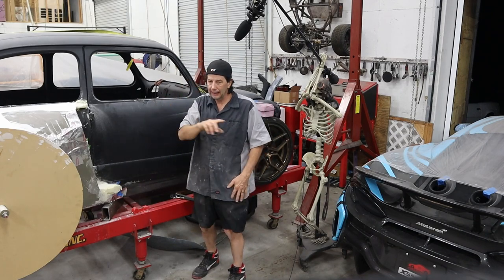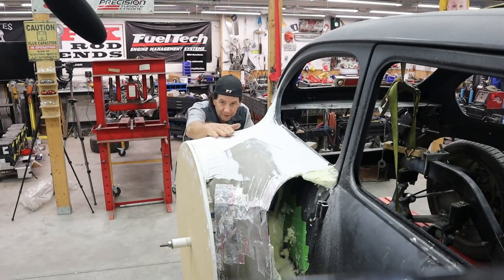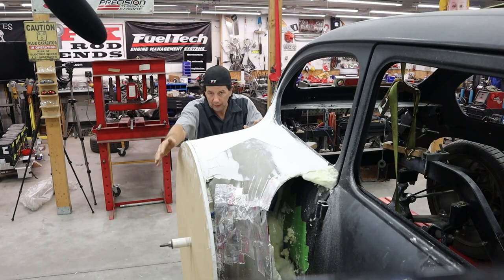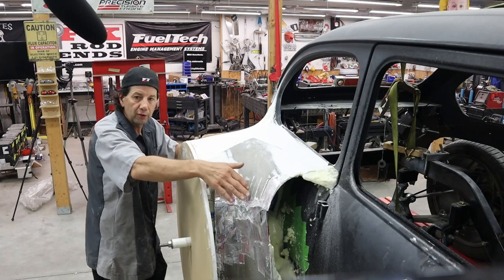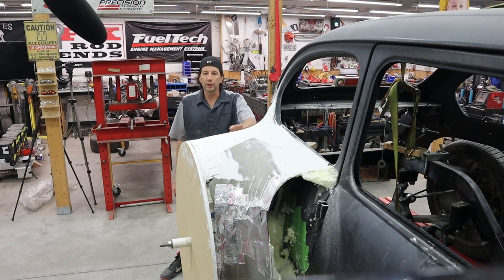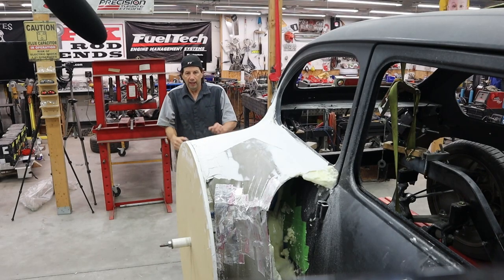Let me turn the camera one more time so you'll get a good idea of where we're at with this upper fender. See how this kind of rolls down nicely — obviously very Porsche-esque in appearance, and that's okay because obviously this was from a Porsche. When I originally laid this out, this is what I saw and it actually looks really good. The back is still up for debate. I do like the way this opening is starting to work out. I had to cut the fender and extend it — this is all going to be filled in with foam and you'll never see this fiberglass part. This was just for templating and kind of give me a general idea. It will go in the computer ultimately, because once I get one side done I'm going to scan it, cut it in foam, and basically make the other side on the CNC machine.